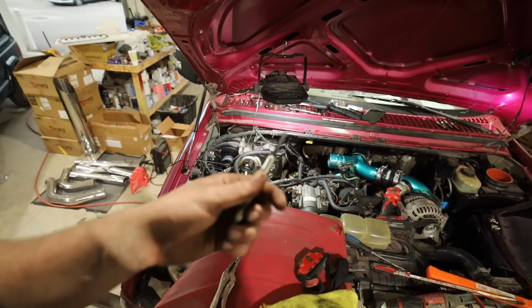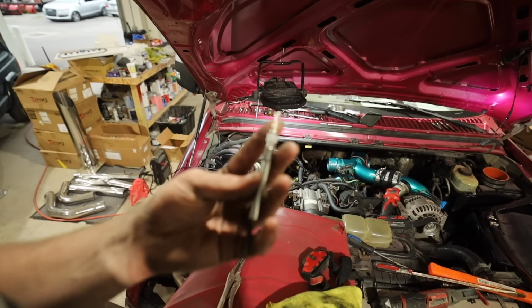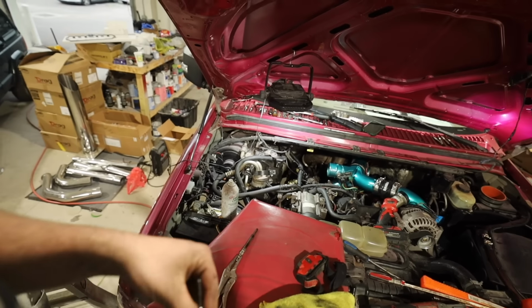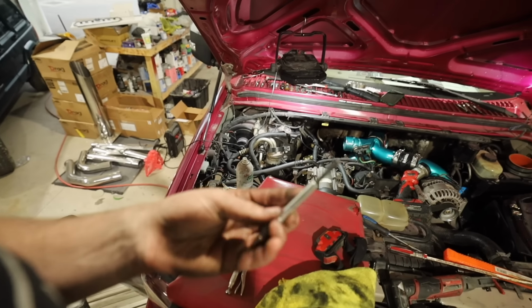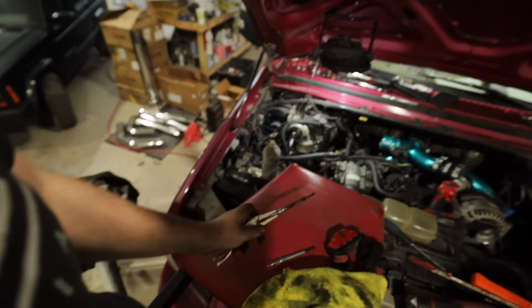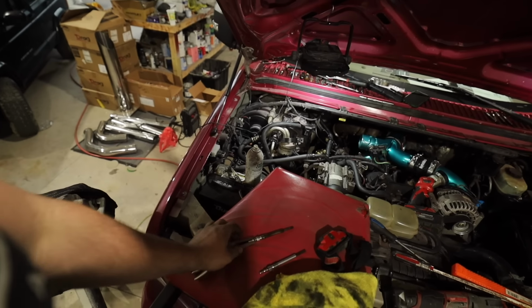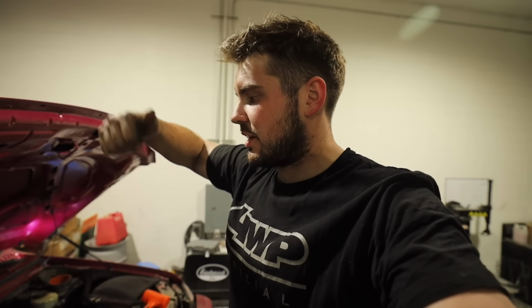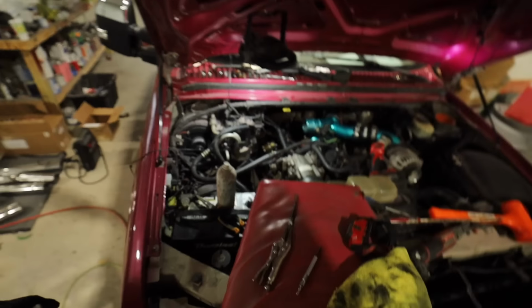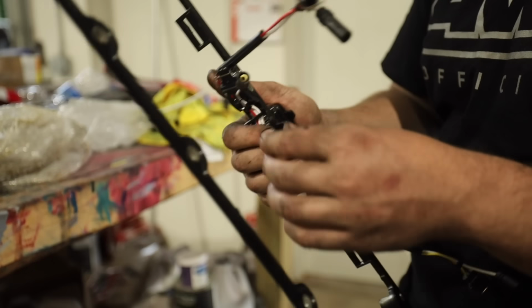But we did have probably about 7 brand new-ish glow plugs, so I'm definitely going to hang on to these in a pinch for somebody because they are only like 11 bucks a piece, and these look pretty much brand new, especially if this is what came out of the last cylinder. The rear cylinder too, I also already evacuated with the pump because it was pretty full. So I sucked out what I could and I'm gonna evacuate the rest with the crank and we should be good to go.